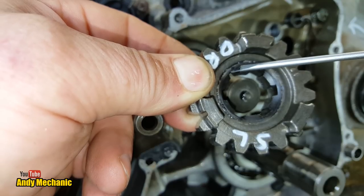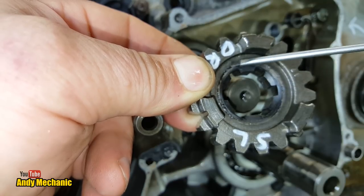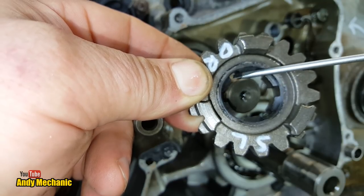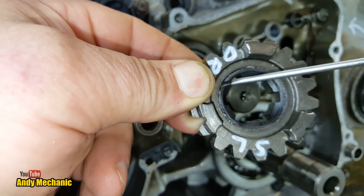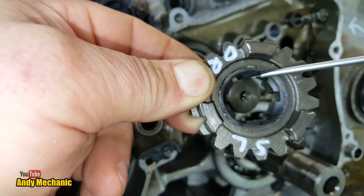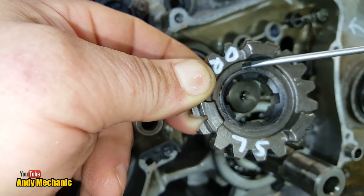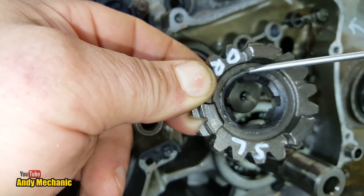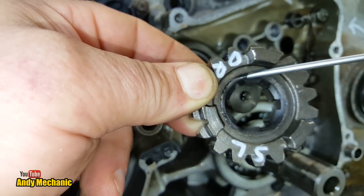Now, the guy said he was in high ratio when it seized up on him, or it stopped. So there's been a speed differential between the collar and the gear. And without any lubrication, there's been a high amount of friction, which has created a lot of heat. That will cause the collar to expand and get even tighter on the gear, which is a downward spiral. The tighter it gets, the more friction there is, and it's basically welded, by the looks of it,